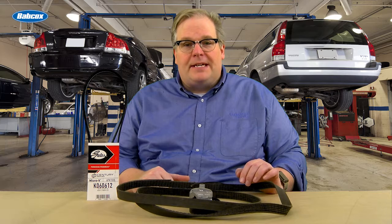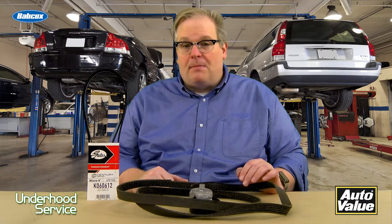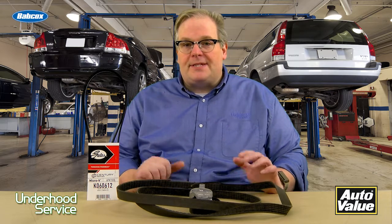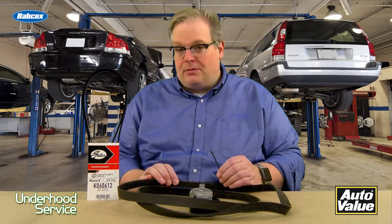Andrew Markell, today's Maintenance Minute. We're talking about belts, and I got 5 tips to help diagnose and resolve a belt noise. Tip number 1, remove the belt. Removing the belt is the only way to see the belt in its entirety and see damage like this that may be hiding behind another pulley or a belt run.